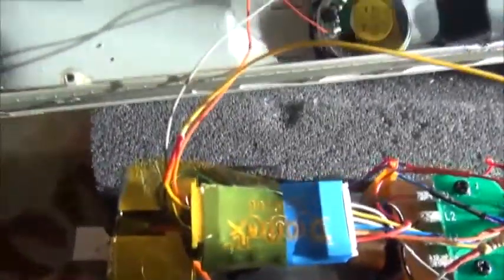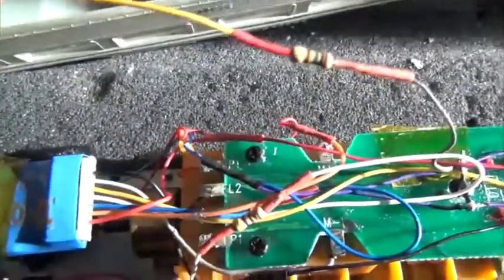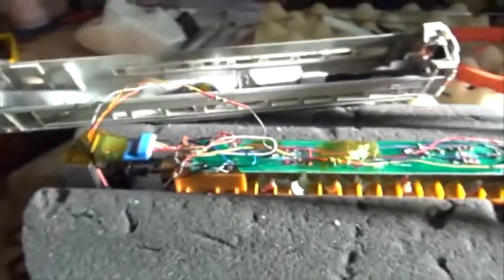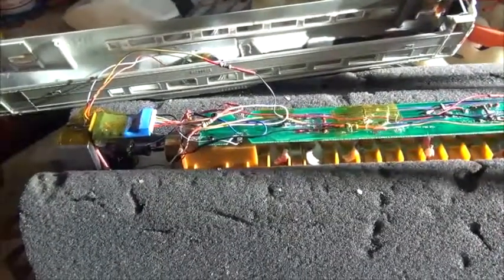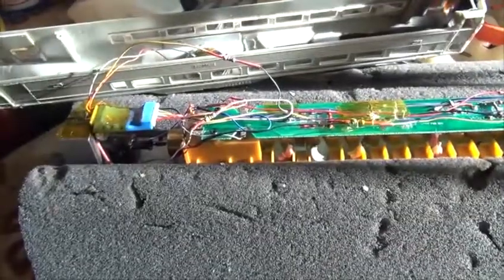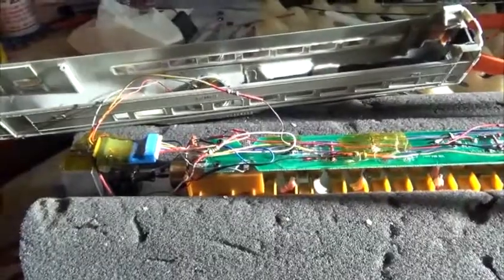What I've done on this one is taken it apart and rewired it. You can see I've got the yellow lead coming off, and I've brought it down and connected it to the green lead that was coming off of F1. I'm going to turn this on just for a second and show you that I can now have the bell and my interior lights without any interference. It's not a big thing really - you just have to open it up.